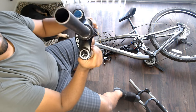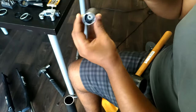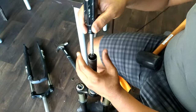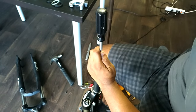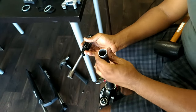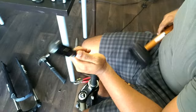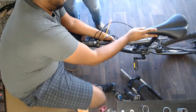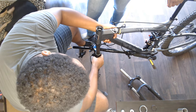Now that the new tube is precisely cut, I only have to lay the old tube that has the star nut inside on top of it and push it in. I've seen people insert a screwdriver in the thread hole to hammer it down, but I strongly believe that would increase the risk of damaging the thread. To make it safe, I use the largest socket I have that can fit in the tube, then use a screwdriver and the mallet to hit it past the old tube into the new one.